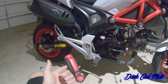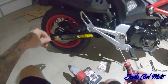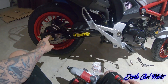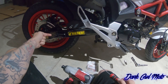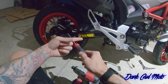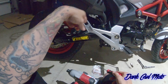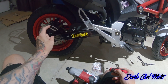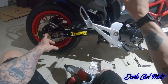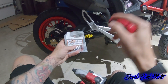The other problem is the chain is super tight. Looking at the back of the swing arm, the adjuster can't move forward anymore. I wanted to swap in a smaller 13-tooth front sprocket, but even just trying to get the stock sprocket back on with the chain this tight was nearly impossible — just a hair of play to work with.